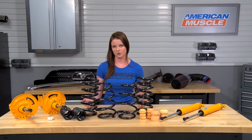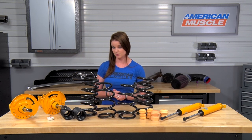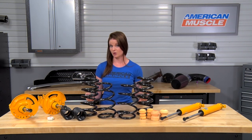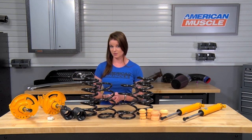This isn't a huge drop, so if you are looking for more drop, Eibach does have the Sport Line springs that will drop a half inch more, but those are going to ride differently than the Pro Kit. They're a more aggressive spring all the way around, and they also aren't available pre-kitted with the Konis — you will need to purchase those separately.